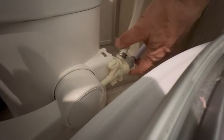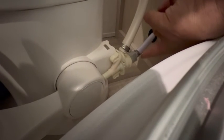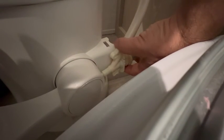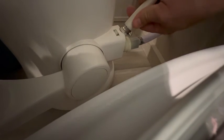I'm going to go ahead and put this back in. To put it back in, you're going to have the lines off of here — I didn't feel like taking these off today because this is still winterized. You're going to put this back in here and it will just click into place, then put that screw back in. That's how easy it is to replace the flush valve on your Dometic toilet.